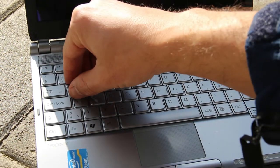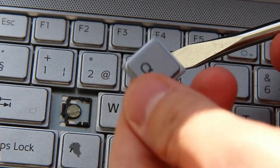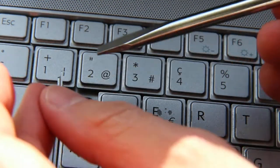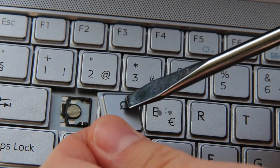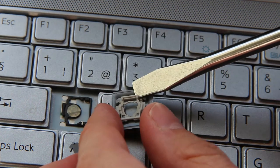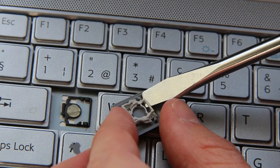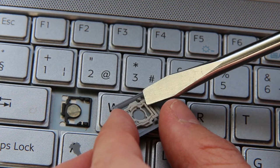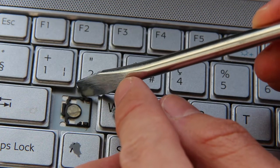After doing a little bit of research I figured out what the mechanisms are and how they work, so I went ahead and took mine apart. Here's a close-up of the Q key — it just pops off and snaps in and out. You don't need any tools. There are about four main pieces: the top piece your finger touches, a mechanism with three hinges — two mounted to the key itself and one that locks those two pieces together — plus a rubber spring and a mount.